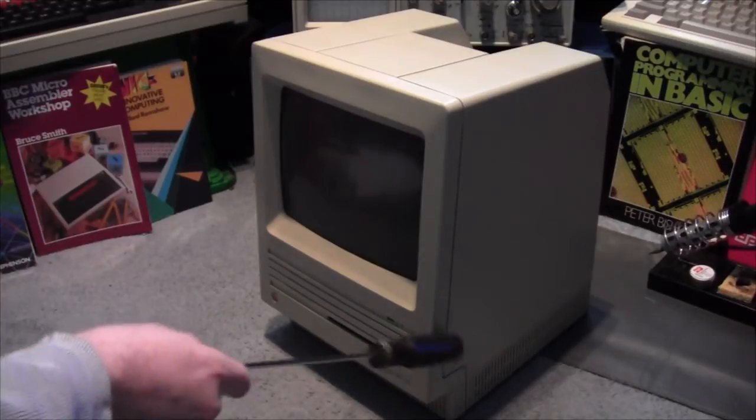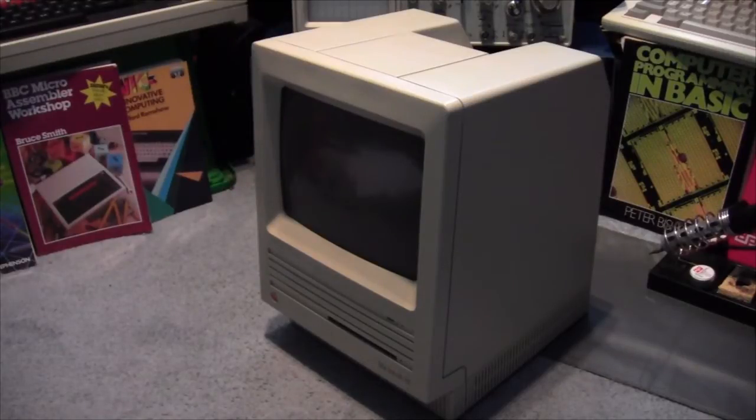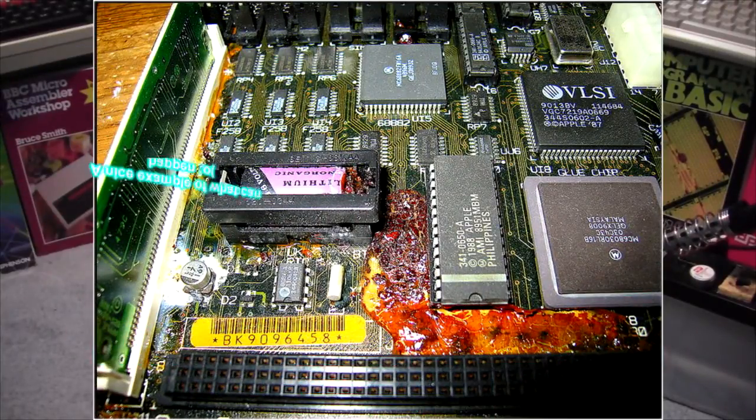Now, the Mac SE, as you'll have seen in recent videos, if you haven't, link below, was picked out of the trash recently. And computers at this age have battery backups that keep the time. And at the age of this one, 25, going up to 30 years old for some of the computers around here, those batteries tend to explode. Computers that suffer from this are Macintosh, your Amiga 500 Pluses, the Archimedes, systems like that. They have battery backups and they can explode. And when they explode, they spurt acid everywhere, all over your motherboard.